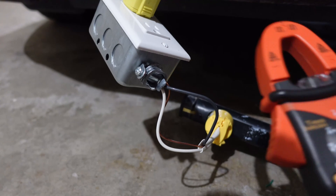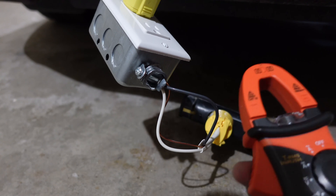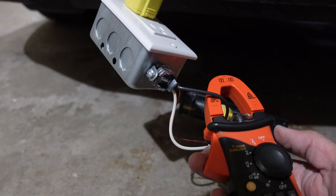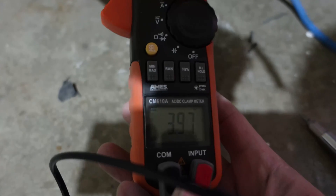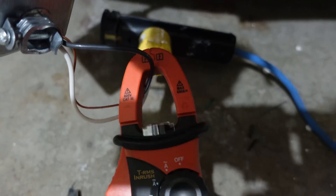If you've got an ohmmeter, I'll show you how you can test your block heater. Method number one is my favorite method to test, but not everybody's got one of these boxes. Take your multimeter, swap it to amps, plug it through the box, and check the reading. In this case we got four amps draw — fantastic. We know this block heater is working.